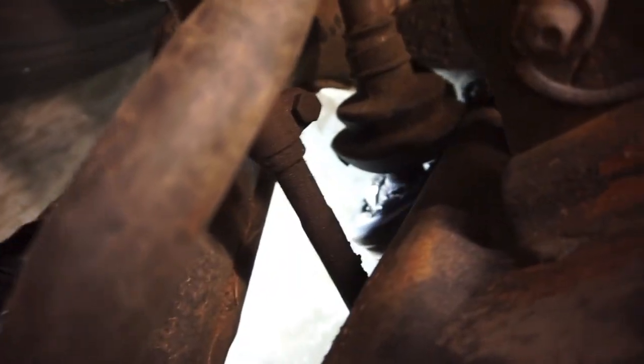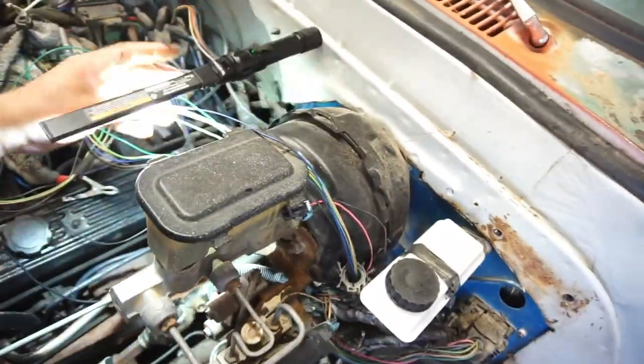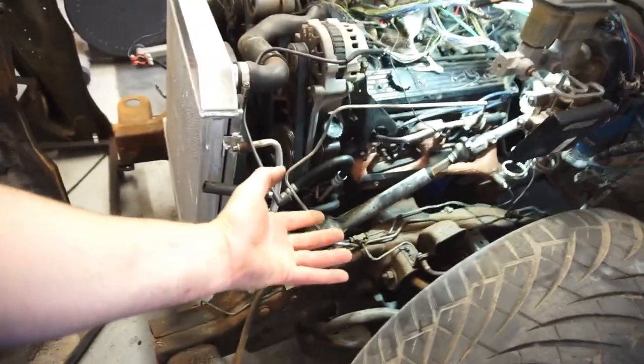Also, I'll have to check everything once I replace the ball joints and everything. But let's see this light. This side's not that bad. But on the other side, this axle is almost about ready to fall out. I'll show you. You see down in there, the little axle thing right there? That thing's about to come out. Which means that I can't go any lower unless I raise that diff, I guess. I'd have to somehow bring that diff up, and I don't see that happening at all. We're already too tight as it is.